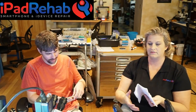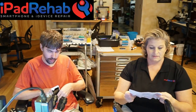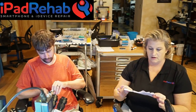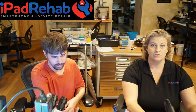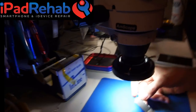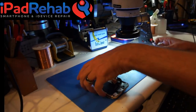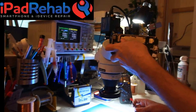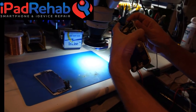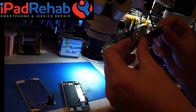All right Mark, here you go — this is an iPhone 6. The note says: Zach, from iFixit in Overland Park, Kansas. Zach said there was a short somewhere on the circuit board, the phone is not getting any power — that's it. Let's switch over to the hand camera. All the shields are still on. Is it bent? There does look like a bit of bend, right about where the NAND is. No water damage visible.